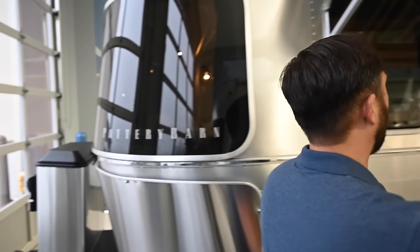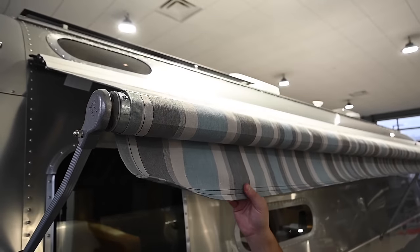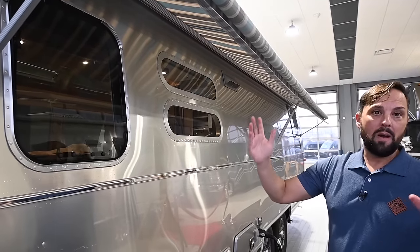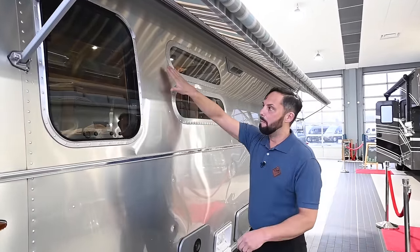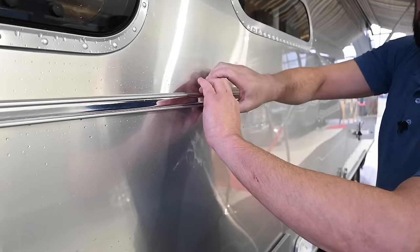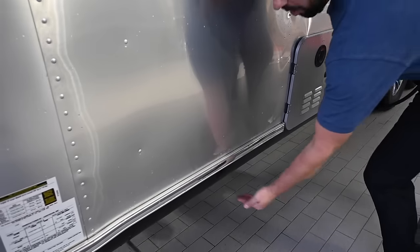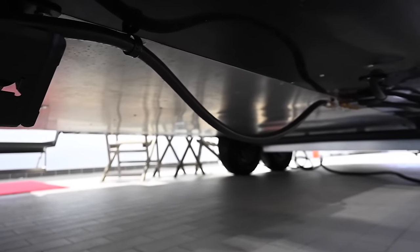Moving back, you can see the beautiful window awnings, which are standard on this model with special umbrella material — it's a co-branded trailer with Pottery Barn. You have a lot of windows; front and rear panoramic windows really open up the floor plan. The windows are tempered glass and tinted. The body is all aluminum, buck riveted into aluminum ribs, with a top sheet and bottom sheet that overlap, then you have the rub rail and belt line protection that wraps all the way underneath. The underbelly is all aluminum, tanks are heated, and closed underbelly is standard on all Airstream travel trailers.